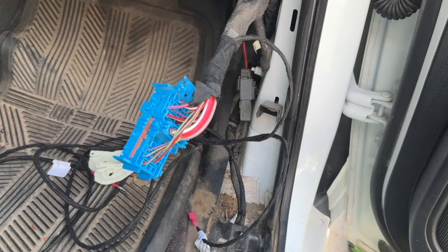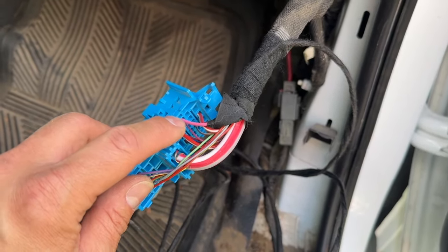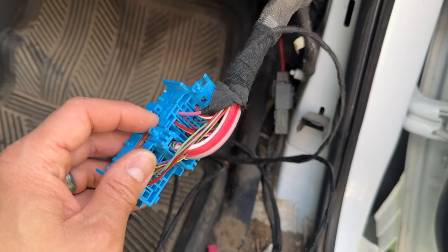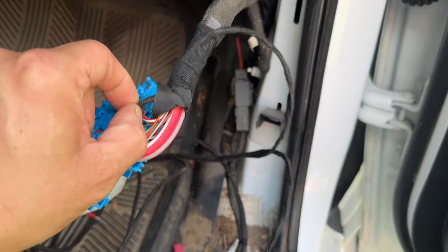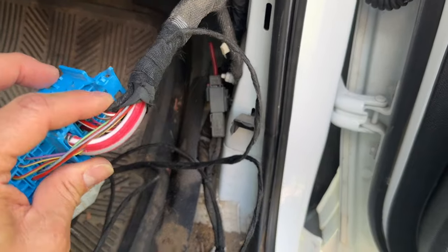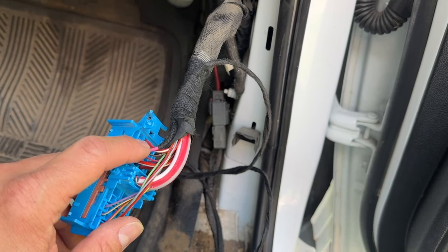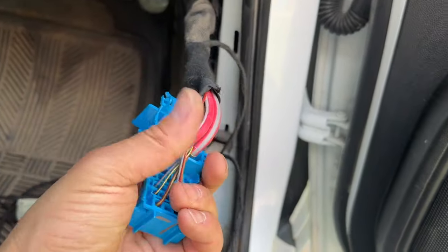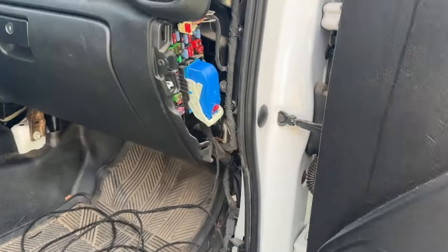That's what it looks like when you're all done. As mentioned, if you have a current powered driver seat you're going to see this wire already present from the driver's side. In that event, peel back the tape, cut the pin off my harness, and splice it into that wire. I do have a splicing video on my channel if you're interested. GM shares the power circuit for the lumbar for both driver and passenger on position 30 of the passenger side fuse panel. The spade for the driver's seat will be left hanging in this area until it's time to install the driver's seat.